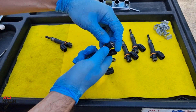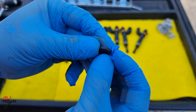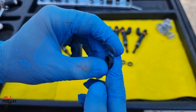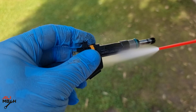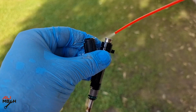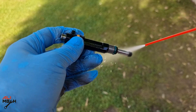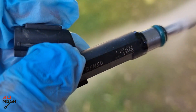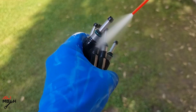For cleaning the fuel injectors, I'll start by removing the upper O-rings first and then give them a good cleaning from the outside. It's a good idea to replace the O-rings every time you take the fuel injectors out, but I always check them — if they have no cracks, I can reuse them. For cleaning I will use carb cleaner. I always get asked why I use carb cleaner and not brake cleaner or something else. If we look at the injector tip closely, we can see how carb cleaner dissolves deposits instantly.